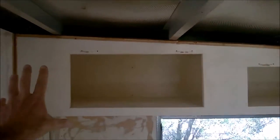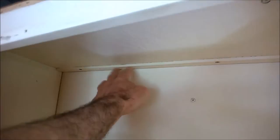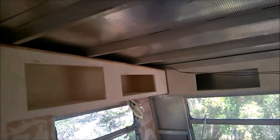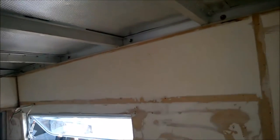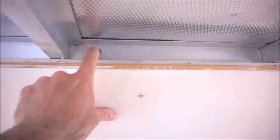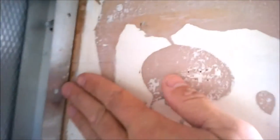This side's easier because I've already removed the cupboards. However, on that side I'm going to have to remove that cupboard as well, and while I'm at it I'm also going to be trimming back the original ceiling right back to the frame, as I have on this side. Once that cupboard's out, an entire sheet can be put onto the ceiling, then once the walls are back on I can put the cupboard back. These things are built from the inside out — on this wall it goes right up into and behind the frame, possibly screwed in past these screws, and pop-riveted in behind the other frame.